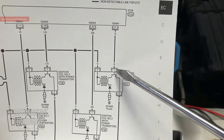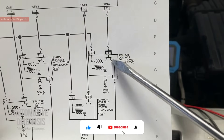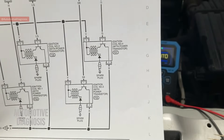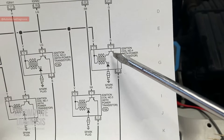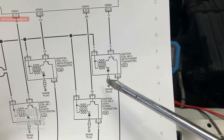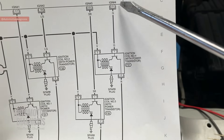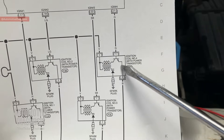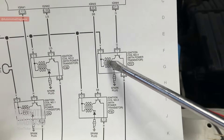The last wire is the trigger for activating the ignition coil. Inside this ignition coil there is a transistor. When we have a coil-on-plug with two wires, this transistor is located inside the ECM. With a three-wire ignition coil, the transistor is located inside the ignition coil itself. So when we talk about the trigger, the ECM is not providing the ground directly on the primary circuit — it's just activating this transistor, and when the transistor is activated we have the ground provided on the primary circuit.